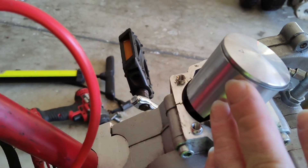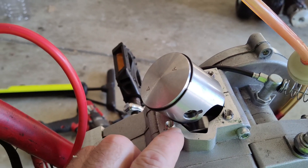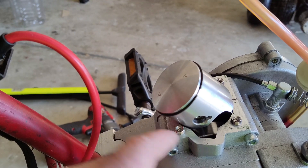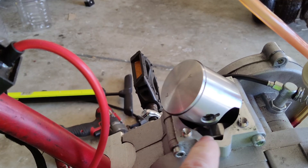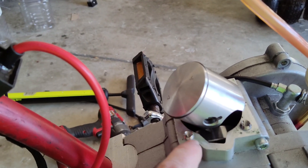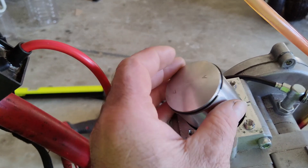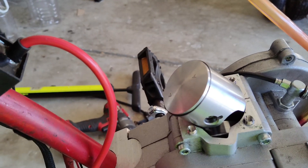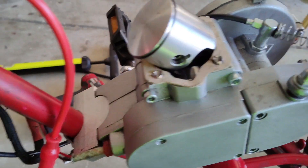I like to leave them about like that all the way around. That way it lets me align the gasket for the motorized bicycle, and I can actually unscrew these by hand. They don't have to be hand tight, but what it is is we're going to use these as an alignment tool, and the spacer will sit on top of this and sit perfectly square with the motorized bicycle bottom half.